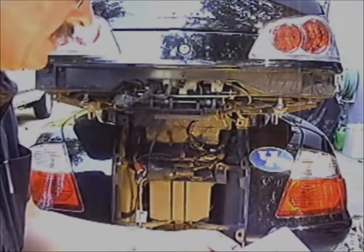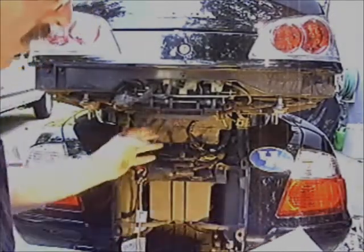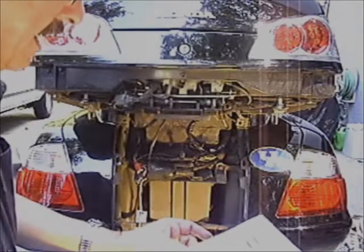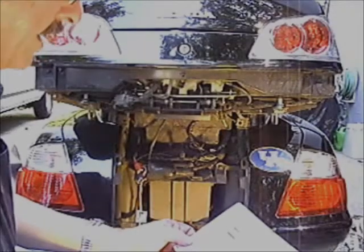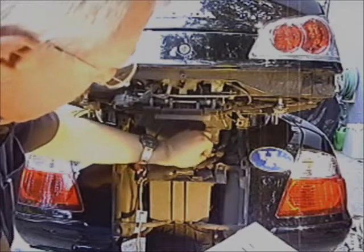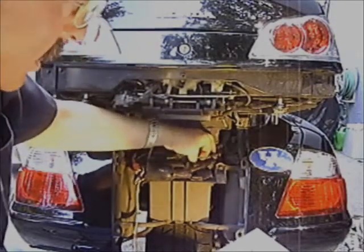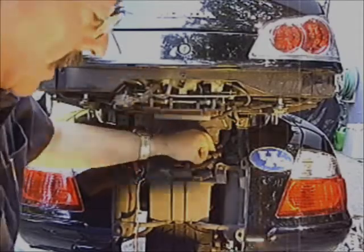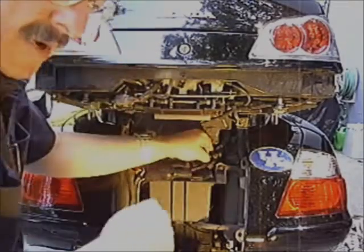Step three says to cut the wire leading to your left brake light at least six inches behind the bulb — we'll be well behind that — and cap the opposite end, which we will not use. Then connect the red wire with the white stripe to your left brake light wire. That's the green wire with the red stripe coming down here. I'm going to cut it so I could butt splice it back together if needed, cutting it right about there.